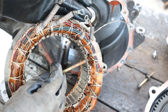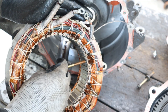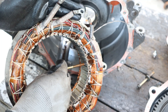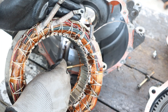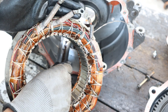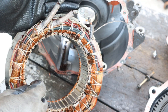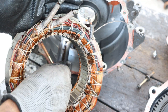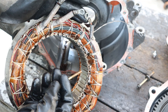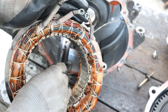Because that rotor has magnets with poles — let's say a north pole — you can energize the stator core to become a south pole and attract it. Then you energize the next core, and that's going to attract it as it rotates. Then you energize the next one, and that's going to rotate the rotor slowly all the way around. We have multiple little cores, which gives you a nice resolution so you can move the motor very slowly but get lots of torque output. That's pretty much how these AC three-phase motors work — it just keeps moving to the next pole over and over.